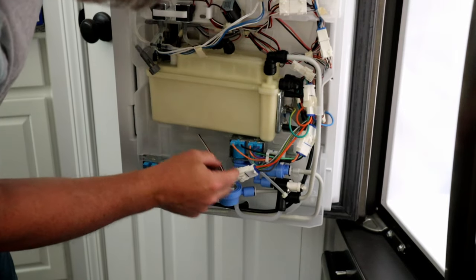We're going to drain that out. While it's draining, I'm going to disconnect the heating element circuitry — this connector connects to the heating element, just press the two tabs on the side and disconnect your tank. And this is what your tank looks like. Here's where the air pump connects and where the blow-off valves are on the top part of the tank. Here's your jumper from the lower tank to the upper tank, your heating element, two thermistors for temperature feedback, your outlet port, your inlet port, and this is your float valve. If anything goes wrong with this tank, you pretty much just have to buy a new one.